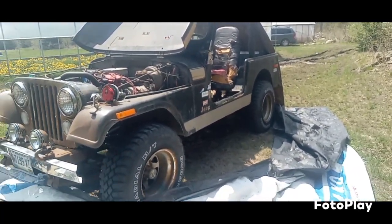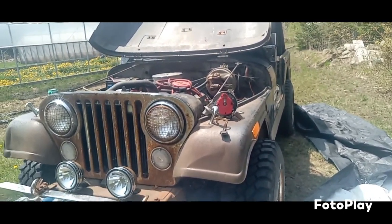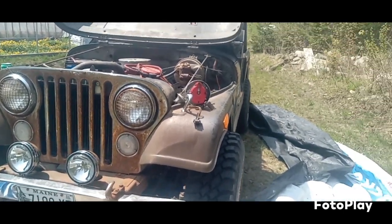Okay, well that's gonna end the video quick. Found out what's going on — the distributor gear is munched. I'm gonna put the distributor back down inside the engine so nothing can get in there, lock the hood down, take a few pictures. We'll probably be back with this project — I've got to come back down and put that gear on and time the motor up for him to get it running.